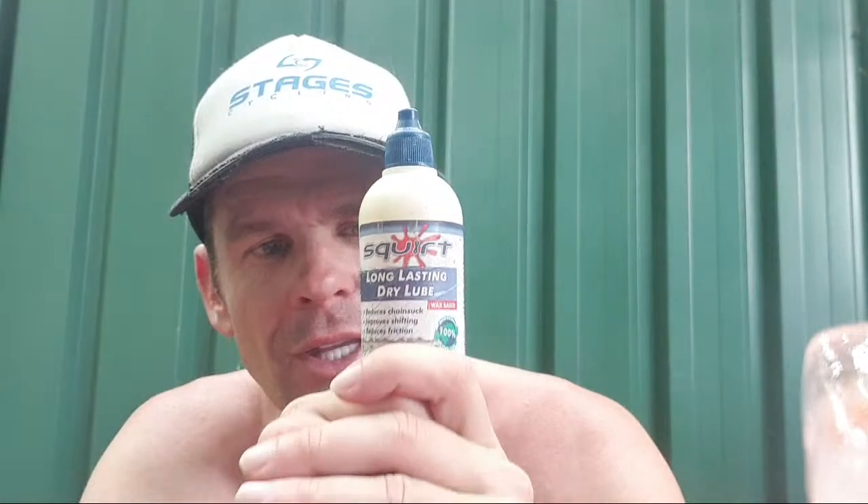You've got to keep your chain clean. I've done a lot of tutorials on how to clean the chain. You want to clean your chain, your cassette, and your chain rings just once, and then you never really have to do it again. It's not like day one where you've got that factory grease. The factory grease is designed so the chain can stay in storage for 20 years and never rust. So it's best to get rid of that factory grease from day one — before you even put it on your bike, chuck your chain in some methylated spirits or mineral turpentine, shake it up, get a rag, give it a good polish, and it all just comes off. Let the solvent evaporate. Don't pour it down the sink — pour it on cement and let it evaporate.